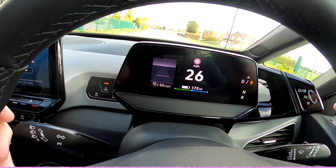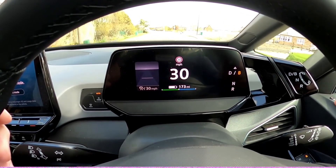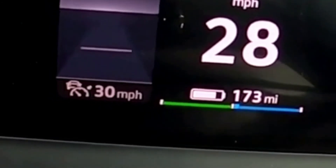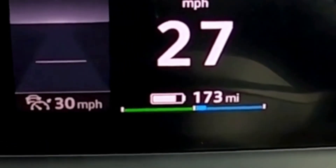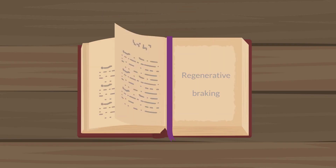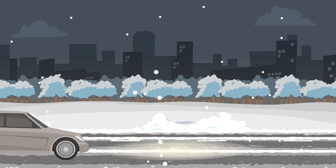So when the vehicle accelerates and the speed increases, this is shown on the blue line. Regenerative braking is taking place as soon as the driver starts to slow down. The vehicle will naturally come to a very slow speed or stop without the use of the vehicle's brakes by using this regenerative braking function. The amount of regenerative braking can be adjusted on most vehicles to suit driving style. Always refer to your vehicle's handbook to fully appreciate the regenerative braking levels on your vehicle, and it's especially important to understand how your vehicle will react in icy conditions.